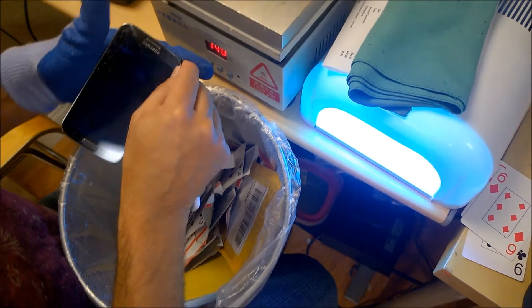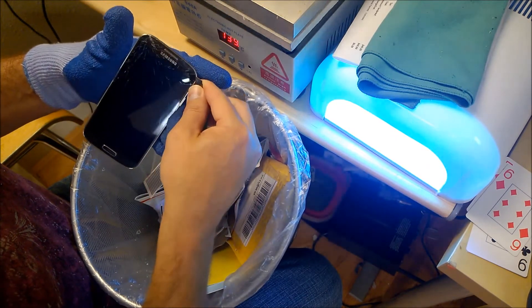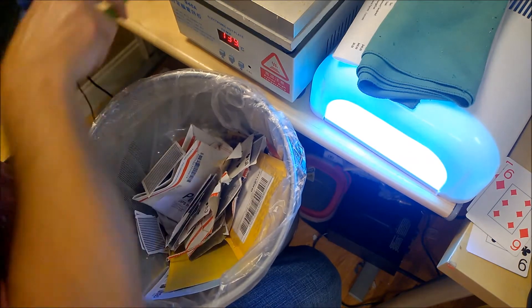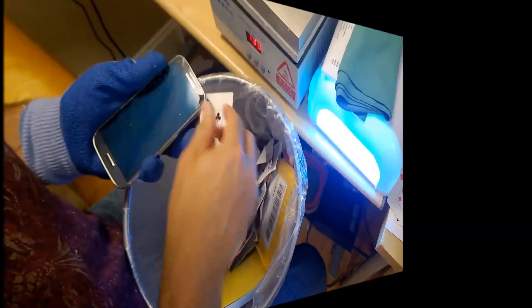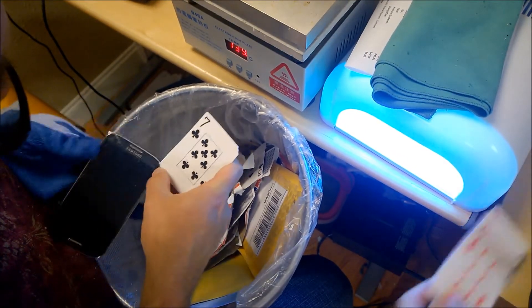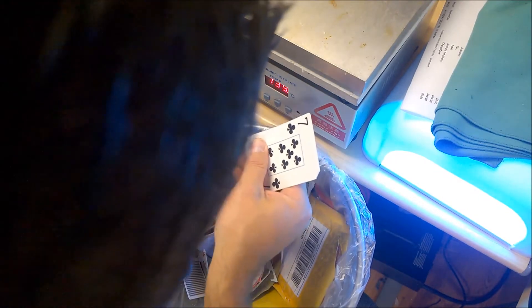You can see he's using a razor blade just to get the prying started. You do want to switch over to something not so sharp or pointy after you get it opened up. The temperature on these has to remain constant. If it gets too cool, you will break the AMOLED. If they get too hot, you will burn the AMOLED. It's kind of a game of keeping everything at exactly the right temperature by heating it repeatedly during the process. You can see here he switched over from a razor blade to a playing card, which is probably one of the best tools for this job.